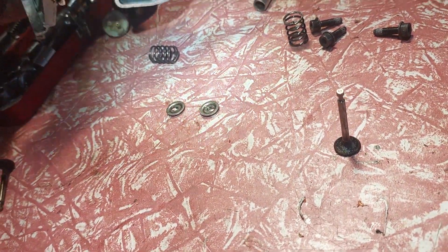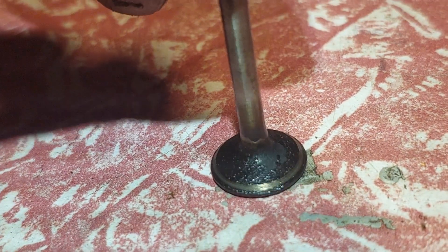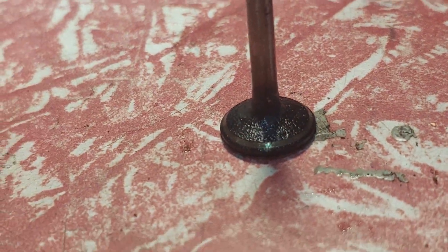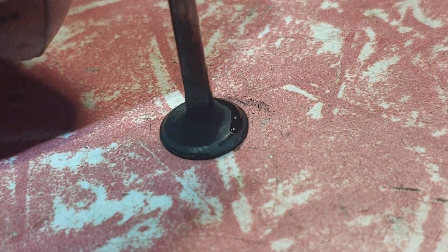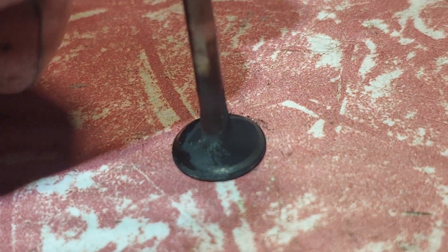So what I did find was wrong: looking at the intake valve, you can see the seat — it gets smaller and smaller and then gets wider again. It's really wide, showing the valve seat wear. Looking at the exhaust valve, the exhaust looks like it's sitting open completely. There's no mark on that at all — just a tiny bit of a mark.